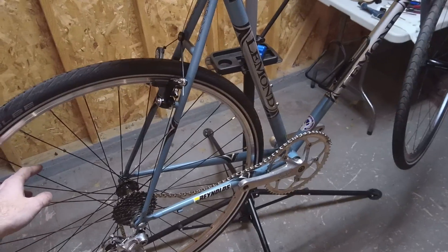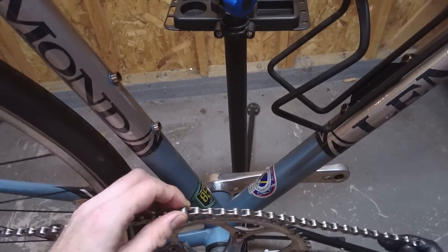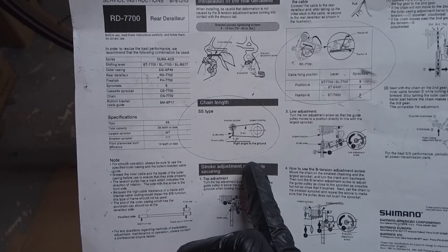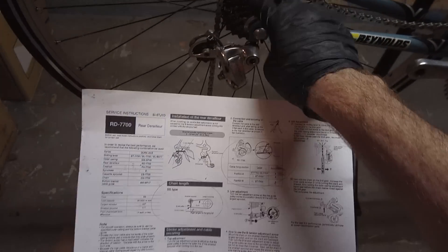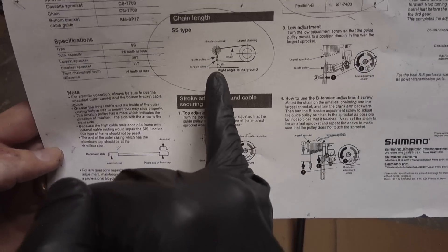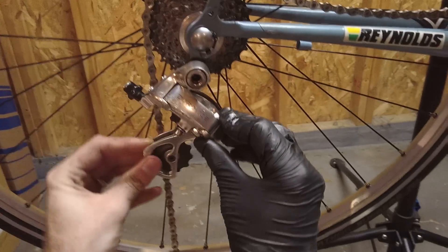There are other tips and directions you should follow when installing a bicycle chain with a new derailleur system you're not familiar with. Go to the manufacturer's instructions for that derailleur — they will tell you exactly what you need. For my rear derailleur, the Shimano RD7700 short cage, you want a 90-degree angle between the ground and the pulleys when the chain is on the smallest cog in the back and the largest chain ring in the front. You can sort of see how the chain is almost straight — basically the pulleys should look like this.